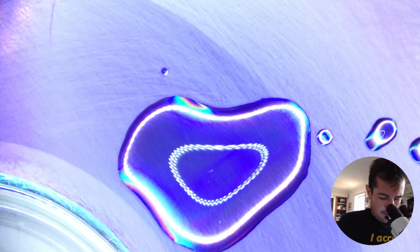There might be one large scratch still there - if you can see up here it's almost cut through, and maybe the 3000 grit will cut through that. Let's get the 3000 grit and keep going. The 3000 grit should be able to cut through - a little piece there, and a little bit of water for our wet and dry. Let's get in with the 3000 and cut it down a bit more. Here are a couple of scratches from our 2000 grit, and you can see the 3000 grit cuts them out. There's the 3000 grit done - you can see it's got rid of most of the scratches. There's one original scratch still there, but it's all cut down. It's cloudy and won't work - we need to do polishing now.